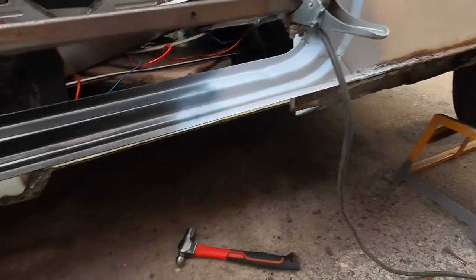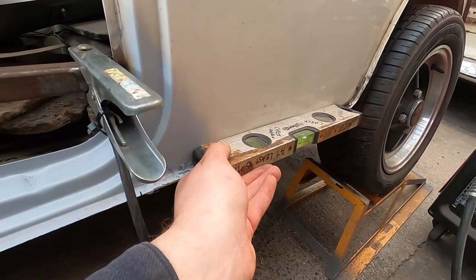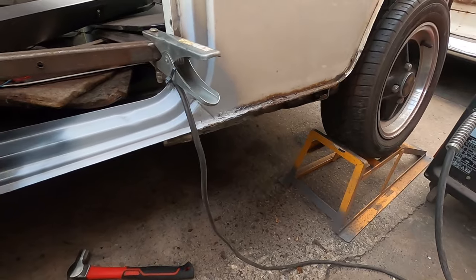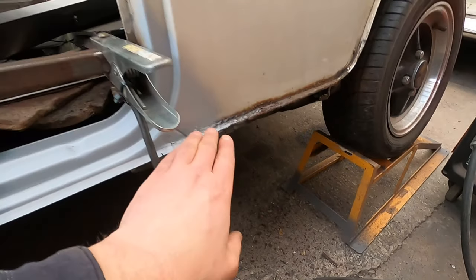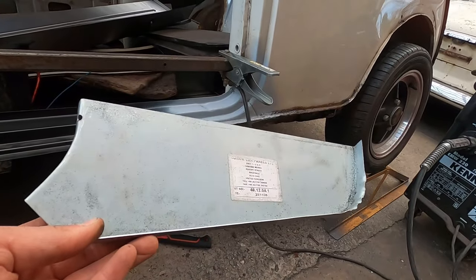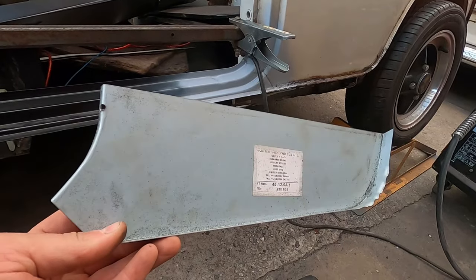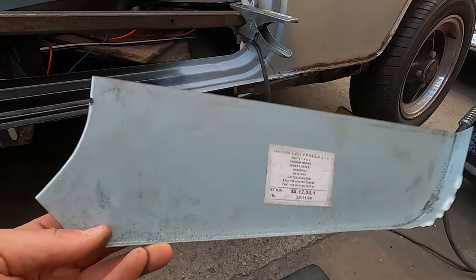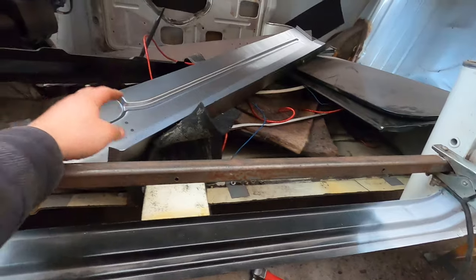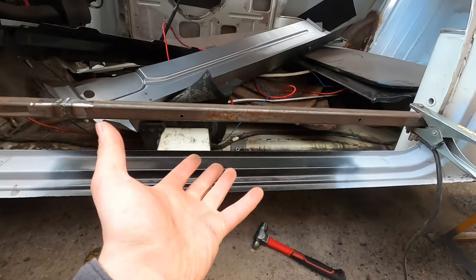Let's get this cut out. All I'm going to do is get some sort of straight edge, mark along there, and take out what I need — run a line all the way along there and cut that off. Then we'll look at getting this potentially joggled — it's a lot easier to joggle it and put it up behind. Then we'll get this welded in and we are basically ready in the next episode to start mucking around with this, putting that up. What do you think guys? I think that's going to be quite productive.